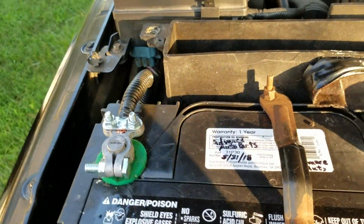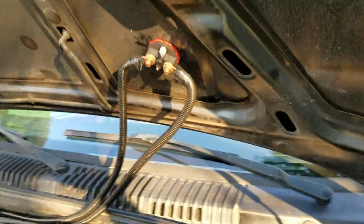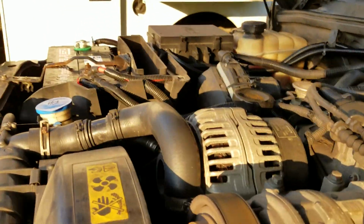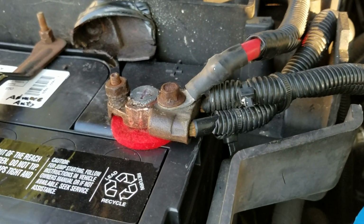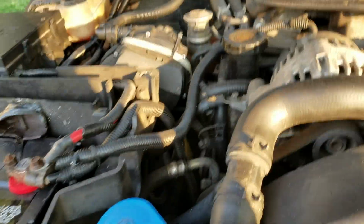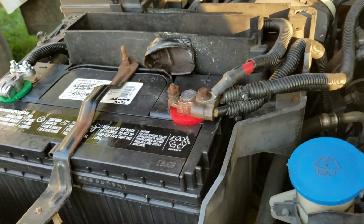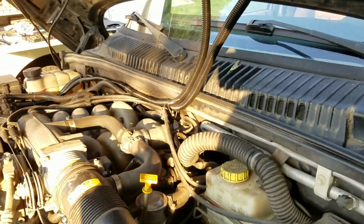As long as we're cutting the circuit off before it makes a complete circle, this will always work. It's always easier to use the ground wire because the ground wire has fewer connectors. If you can see my positive wire, there's a lot of different connections on there. I would have had to splice all those together and make them into one, and then come back to it. So it's easier when it's just one wire like that one. As you can see, this problem I had actually killed my battery. This is a new battery I just bought at Advanced Auto Parts because it kept draining so much that eventually the battery wouldn't recharge. So that's basically it. That's the kill switch, and I'll show you what it does now.